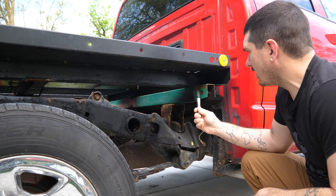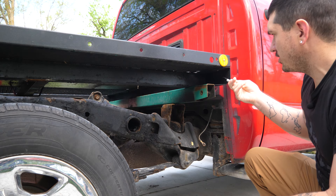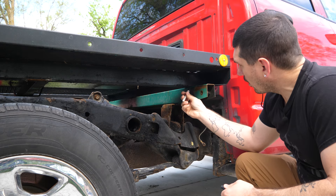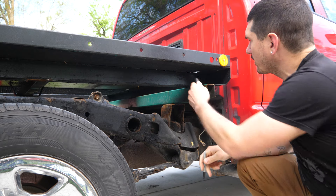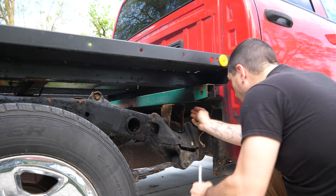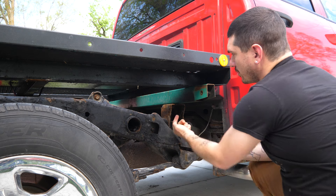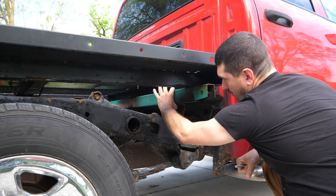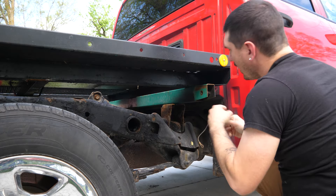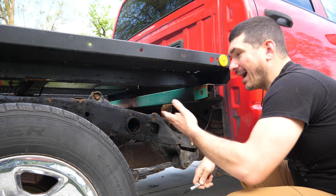I'm going to tackle the front first — find out where the holes need to be in the main support, that little green bar. The two main supports on the trailer are left and right, fully boxed, and everything else is like a C-channel. I'm going to mark where this ends and cut it off so it looks a little cleaner. Then I'm going to mark where the main hole is, making sure it's on center. We're going to drill straight through and get a bolt that goes all the way through and clamps down. I'll go do the same on the other side, make all the cuts, and then put it back in place and space everything out.